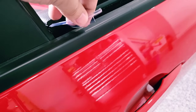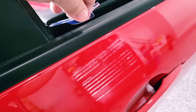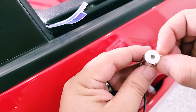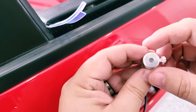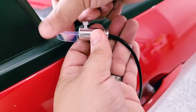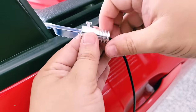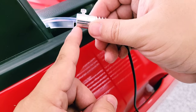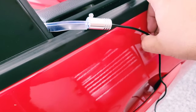Do that 90-degree cut. Then grab one of the diodes — I recommend using the long ones on this occasion. Open this up — you can do it with your hand. If you look inside it's like a clear plastic screw, so open it so the hole is exposed. Go ahead and connect the fiber optic, make sure it's all the way in, and then secure it with a hand-tight — just enough until you feel it's nice and tight. You can add tape on there if you like. Maybe less than half an inch of the insert is more than enough. Then drop this diode inside the door panel and route the cable inside to the car.